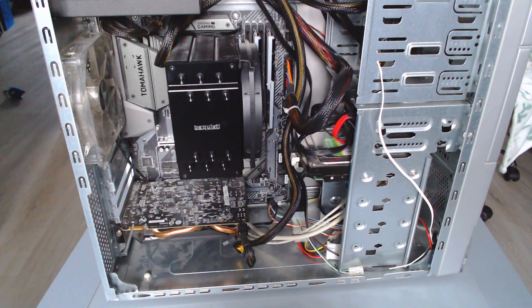As for the testing, I'm going to run Prime95 for a few minutes and see how the temperature evolves, then compare it with the same test after moving the CPU fan to the back. Something worth keeping in mind when moving fans around: make sure the fan is blowing air in the right direction. The side where the fan blades are exposed is where air comes in, and the side with the little motor supports is where air gets blown out. Keep that in mind, otherwise you might have them pulling or pushing in the reverse direction.